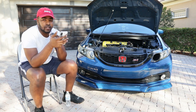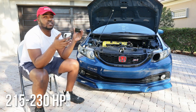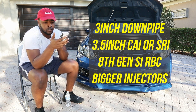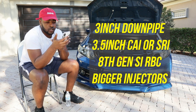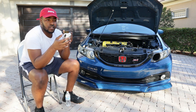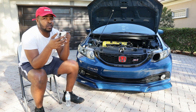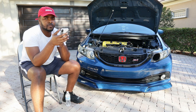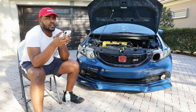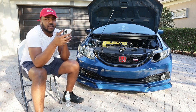For people who want to make 215 to 230 horsepower, I recommend a 3-inch downpipe, a 3.5-inch cold air or short ram intake, an RBC intake manifold — or a port-matched RBC — bigger injectors, bigger throttle body, and E85. I was on RDX 410cc injectors running 93 octane; now I'm on 550cc injectors. For E85 I recommend 550cc injectors. My max duty cycle right now is around 85%, which is where I feel comfortable.